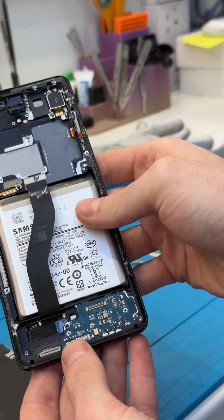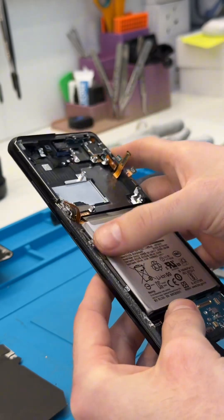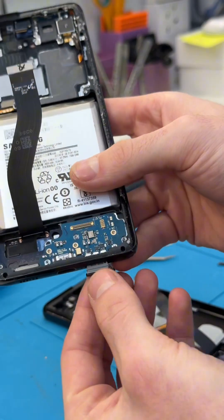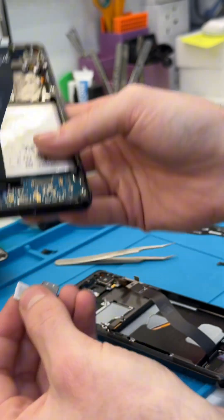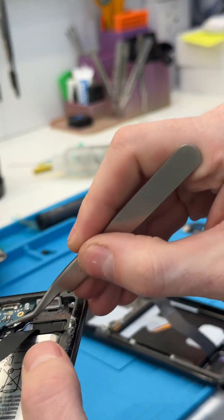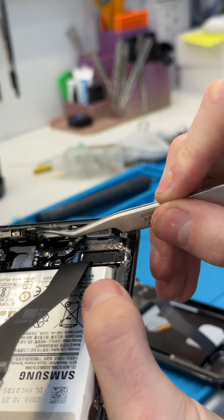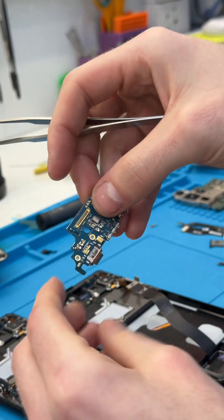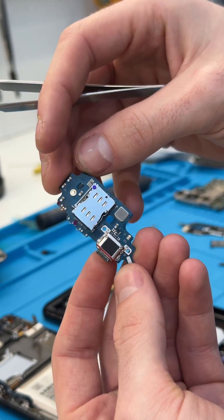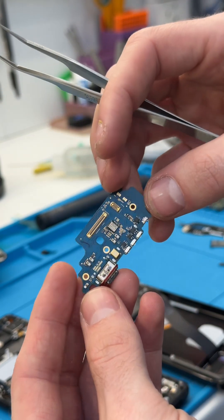I'm going to put it back down, and we're left with the rest of the frame — a couple of screws to remove, the charging port, a little bit of heat to get that battery out, a couple of little components like the front cameras, and the antennas on the side. What's interesting about a lot of devices these days is the charging ports double up as your SIM card slots. If I pop that out gently, I can pop out the entire charging port board assembly — and that is your SIM slot inside. So if you're having SIM card issues or errors with your SIM being read, it might be worthwhile replacing your whole charging port unit.